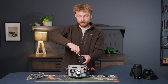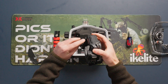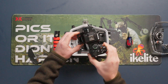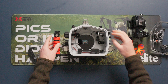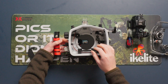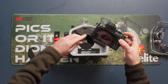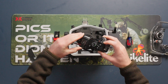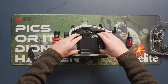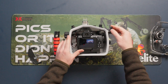Any misalignment here will result in misalignments on the buttons in the housing. You'll also notice that there's a back wall on this mount, and that'll go right outside the screen of the camera. Once that's on, put it to the side. We're going to make sure that all of our controls are pushed out of the way, and we're going to grab our hot shoe and just slide it into place. Make sure to push it all the way forward, then simply slide it into the housing and realign our controls.